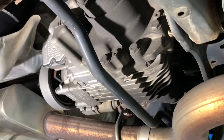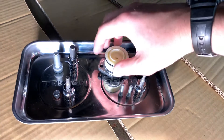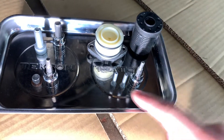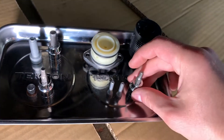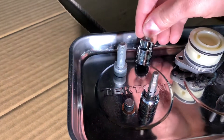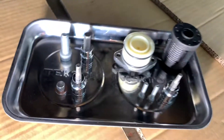Underneath here is your rear differential and Haldex unit. Before we get started, I'm going to go over the different bolts and pieces. This is the cover with the O-rings for the Haldex filter. This is the filter itself. Then we have two bolts that hold that cover on — they use a 4mm Allen. The fill plug for the Haldex fluid uses a 5mm Allen, and the drain for the Haldex fluid reservoir uses an 8mm Allen.